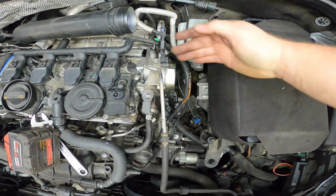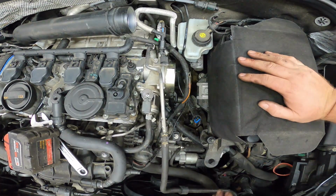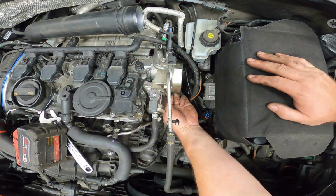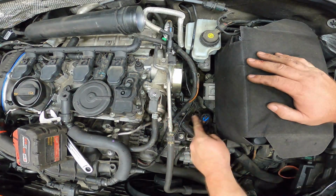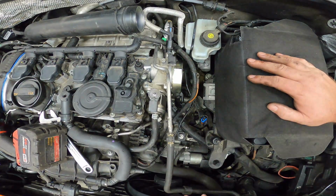And with that, we've just reinstalled that gasket, put everything back together in reverse order. Start it up, and check underneath here for leaks, because that's what we had. We had a big oil leak coming right here, dumping all over top of the transmission. But with that, pretty much did it. I knew you could, and didn't doubt it for a second.